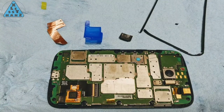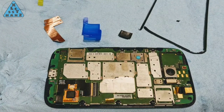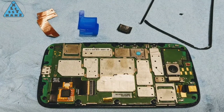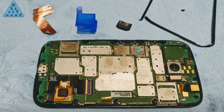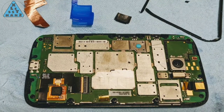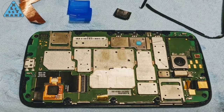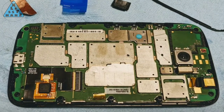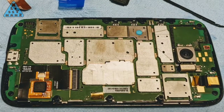The only parts that had a hard time with the lacquer thinner seemed to be the rubber parts and the glues. For my purposes of dismantling phones, it's good to confirm the thinner will melt the glue. In this pile of parts, the rubber padding around the camera, USB port, and screen sort of melted off. The lacquer thinner seems to dry pretty quickly, but to be sure I'm leaving everything out to dry for at least 12 hours. Once that's done, I'll try the power-on test.